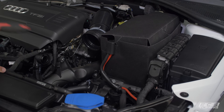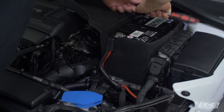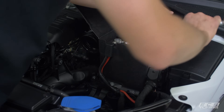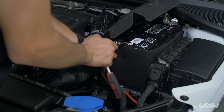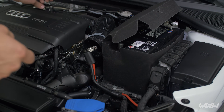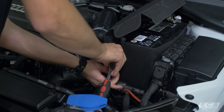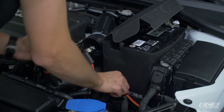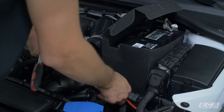Next, we've got to pull the battery out — we'll pull the battery and the tray out and we'll also need to remove the ECU. So we'll start with a 10 millimeter, pull off the negative terminal first, followed by the positive. Then we'll loosen up the battery tray and get the battery off. The tray is held down by a 13.